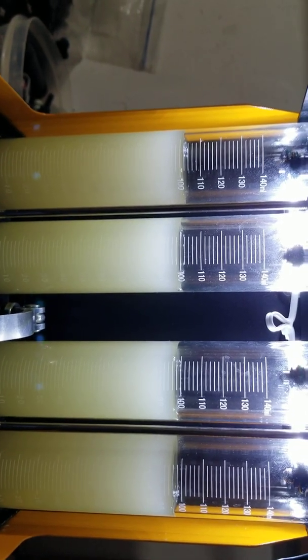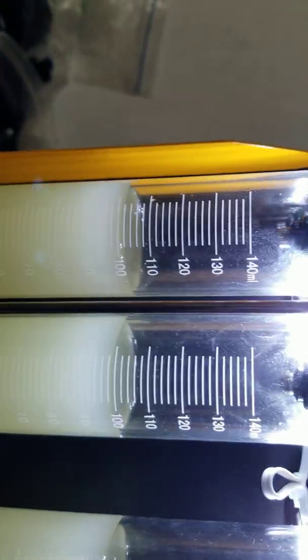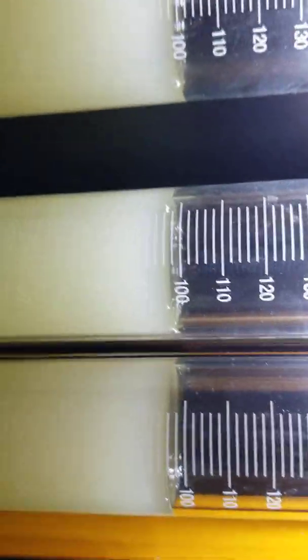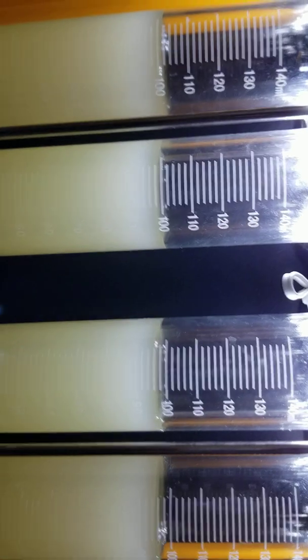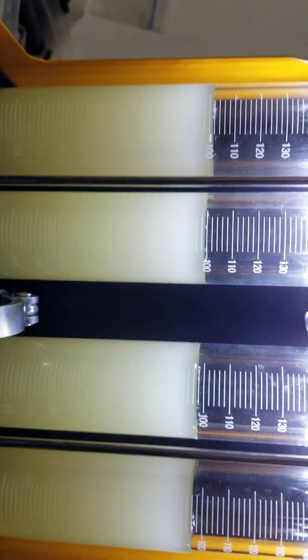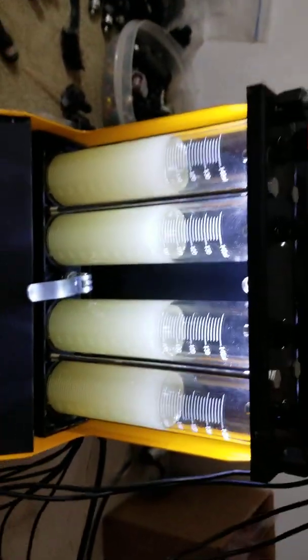There's a little bit of variance, but not much. Looking at the numbers: ID1000, Bosch 95, ID1000, Bosch 95 — they're all pretty close and comparable to each other. That one Bosch 95 near the gauge is a little lower, but compared to its own set it's within a few percent, which is passing. Bosch's factory static variance tolerance is six percent, so anything matched within one to two percent is perfectly fine. They flow the same amount of fuel statically, and dynamically they're spot on.